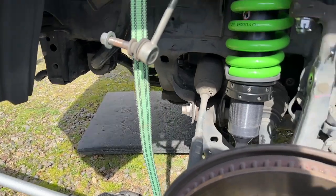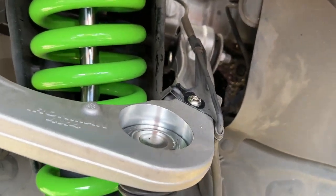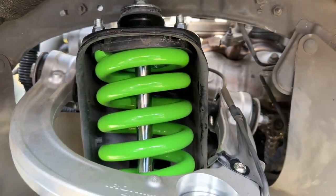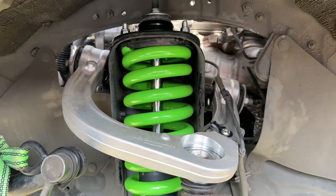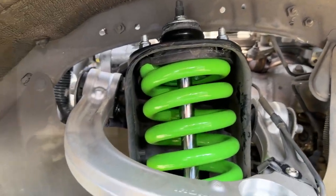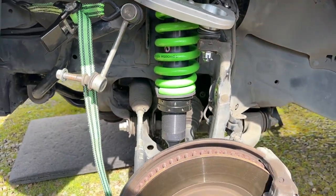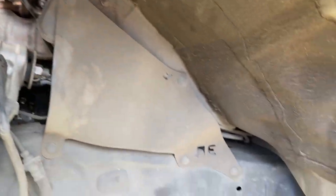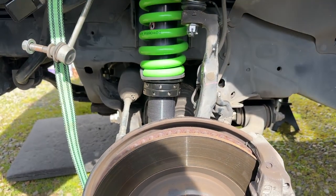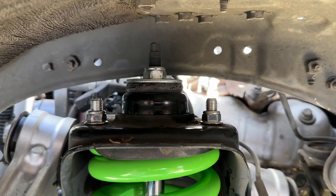Good progress — it's all in there. I've tightened everything, drilled out the bracket, put the stainless screw in with a little blue Loctite. One thing everybody says: don't tighten the bolt through the upper control arm until it's set down at ride height, because that's where the bushings will live. I have it supported on the jack stand so the suspension is holding the weight at ride height, so I tightened it. Worst case, in a few weeks when things settle, I'll loosen it and retighten. Iron Man also provides a standard shoulder nut — works great.